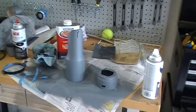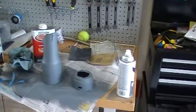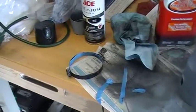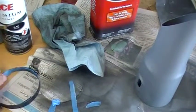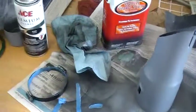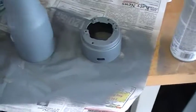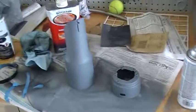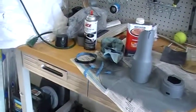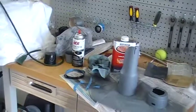Well welcome back. While I was priming the column and getting it all finished, you were getting your battery charged — so welcome back. We're ready to put some color on this thing now. Let me show you a little trick I've done though. See this fan clamp right here — it's used to hold the tachometer on the column, slides down over that. It always scratches up my column, so I thought I'd take some painter's tape, line around the inside, trim it out, and stop that scraping. So let's throw some color.